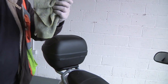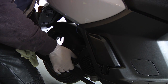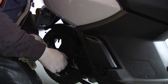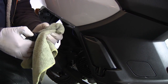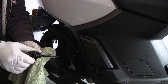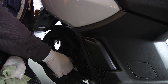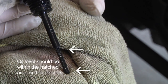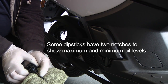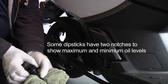Unless you want dirty fingers just before you go to work, use a little piece of rag on a cold engine. Undo the oil filler and combined dipstick, take it out carefully, try not to drip oil everywhere, and just give the dipstick a wipe. Resting the dipstick in the filler hole — not screwing it in — we withdraw it and check that we have engine oil, preferably near the top, but we don't overfill because that's as bad for an engine as having too low a level.